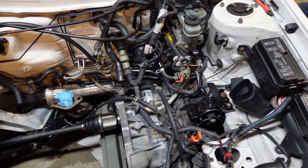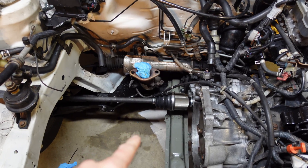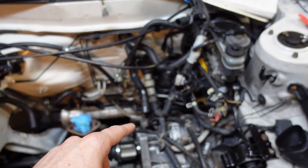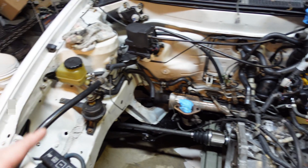Here's a quick look at the engine bay. I've cleaned off the transmission, put in new motor mounts, and got a new axle since the old one was leaking grease. I've cleaned the power steering reservoir and put in all new hoses for the power steering — some of those were cracked. I'll probably reuse the two coolant hoses for the heater as they look to be in good shape. I've maintained and serviced this car very well in the 15 years I've owned it. Any questions or comments, leave those below. If you want to purchase a Litime battery, there's a link in the video description. Please hit that like button and thanks for watching.